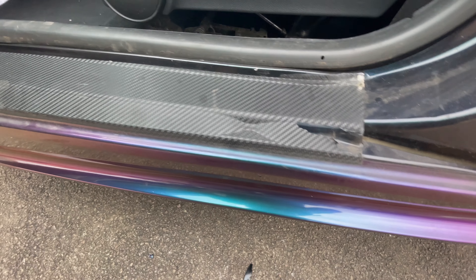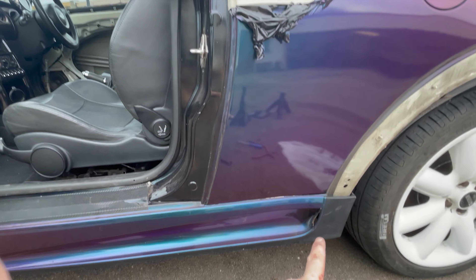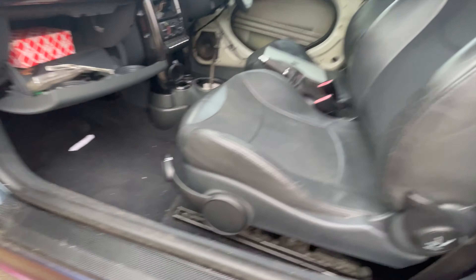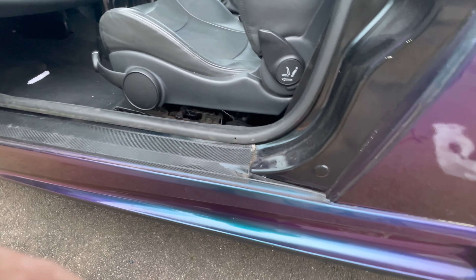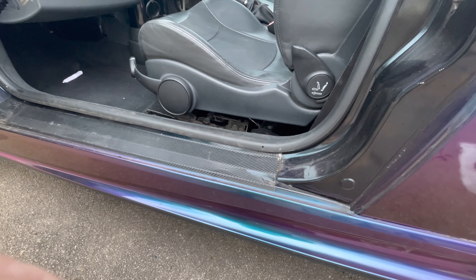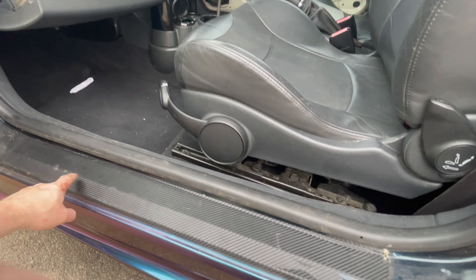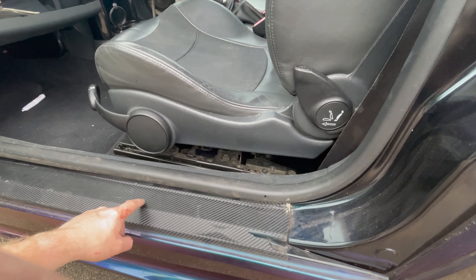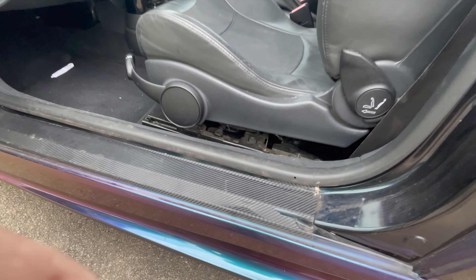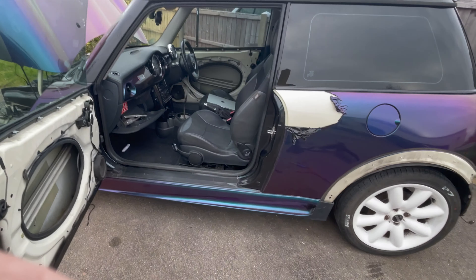The clips are designed to break before the brackets, so it'll sound horrible but she will come off. You've got your screw off at the back and all your push pins along the bottom. Next job is to actually pull it from the car — I'll pop the camera down on the floor. There should be sticky double-sided tape across the top, but the tape's gone dry on this one so it's already disconnected, which should make it really easy to take off.